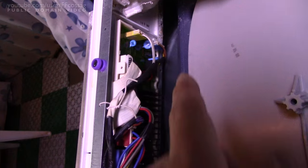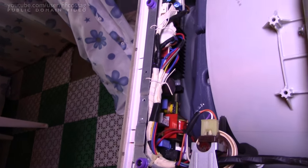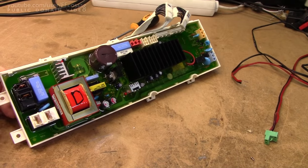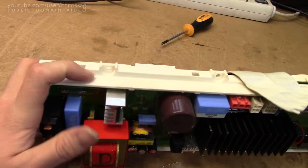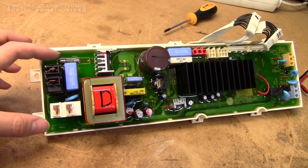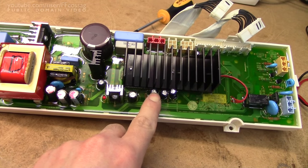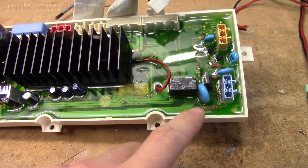There's a little tiny relay there which made a little rattly noise which I didn't quite fancy. I'm pretty certain the issue is going to be on that board, and it's going to come out either way. The entire front-load module pops out quite handily with the front-load PCB, which is just one of those cheaper boards, and the big power supply on the back. The horrible part is that this entire thing is potted into the plastic - peeking through these little holes there doesn't seem to be any opening in the white plastic on the underside. So basically I'm going to have to carve this entire board out in order to be able to probe anything.